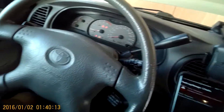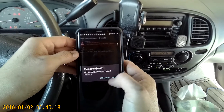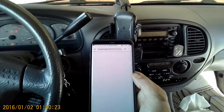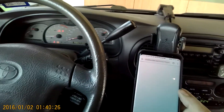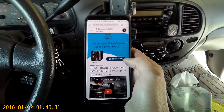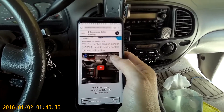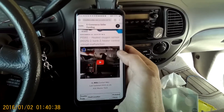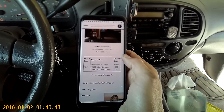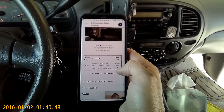I know this check engine light pops in and out every so often, so that's the current fault. Web lookup — let's look it up on the web for trouble codes. And these sensors aren't cheap, they're like a good couple hundred bucks. It moved on — well, it's a heated oxygen sensor, bank 2, heater control circuit malfunction. Heated oxygen sensor, bank 2 — so it's just like wiring. Is it a fuse maybe?